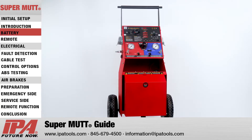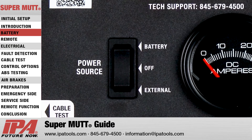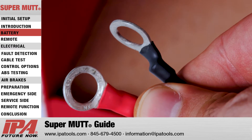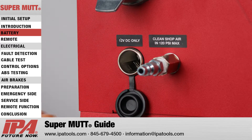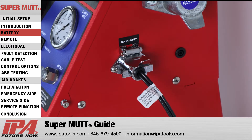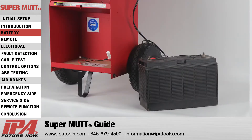To begin using your MUT, you will need to supply either a 12 or 24 volt DC battery, depending on your trailer's needs. The MUT comes with two options for power input. The SuperMUT has a specially designed battery cabinet sized for a Group 31 battery. To install, simply attach the supplied ring terminals to the battery posts. Power can also be supplied by an external source, such as an AC to DC power supply or an additional battery. Using the supplied two-pronged external power connector, simply attach your power source and plug the socket into the receptacle on the left-hand side of the unit.